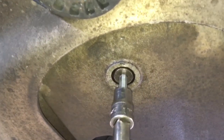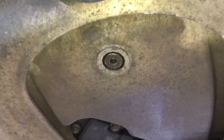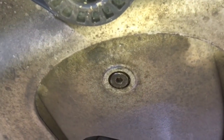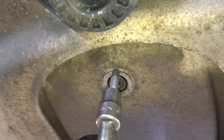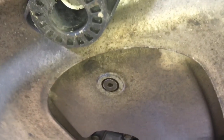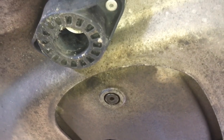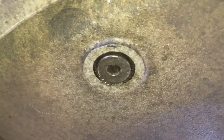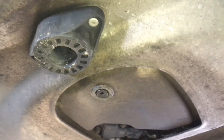This has happened during maybe the last person or the second last person to put a sump plug in — they've obviously over-tightened it and therefore stripped the thread. Amazing that it's not really leaked; there is a wetness to the bottom of the sump but it's not actually leaking. Even though I'm unscrewing it, there is no oil dripping out of it. But now I've disturbed it you can just start to see the trickle or a shine of oil coming down around the outside.